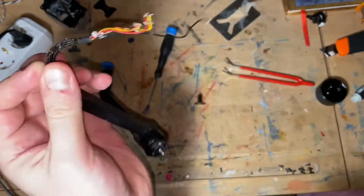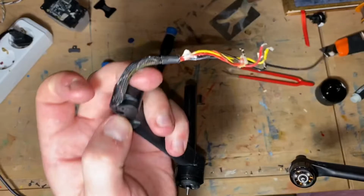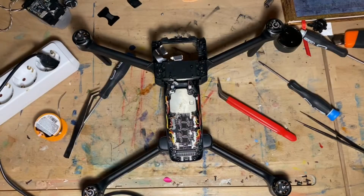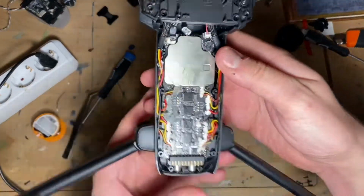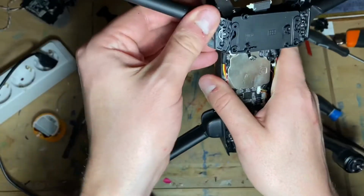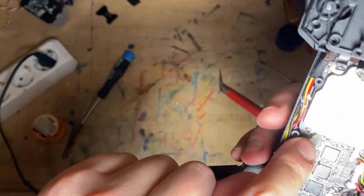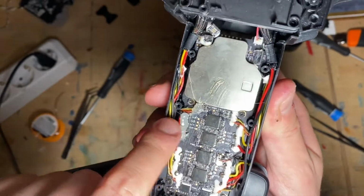It's out. Now, what I'm gonna do next, I'm gonna set this busted drone aside. I'm gonna prep the leg and we're gonna try to fix my other drone. Okay, before I proceed, let me show you what I did so far. Put on the bottom cover on my drone. So install the leg, put on this cover right here, soldered on the controls and the power to the motor.